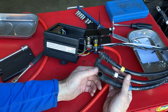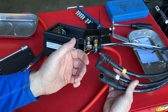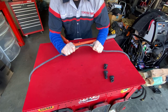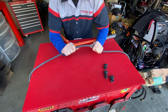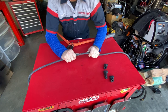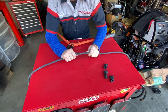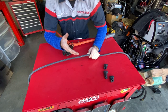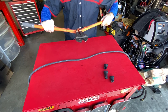We disconnected the three cables that we have to make longer. Now we're going to show you how to make longer ones with a special hydraulic crimping tool that we bought. The type of cable we're going to use to extend the lines is welding cable — a number two Temco Easy Flex. We're using welding cable because it's usually very high quality and the wire size is true, so we know a number two size is going to be very accurate. We figured out what length we had to make all the cables, and we're going to cut it using two-foot-long bolt cutters to snip the wire.